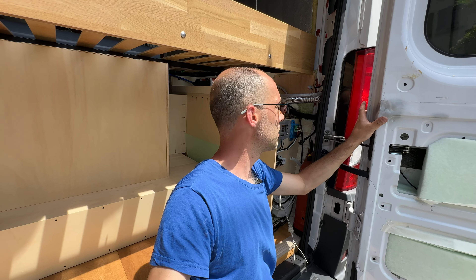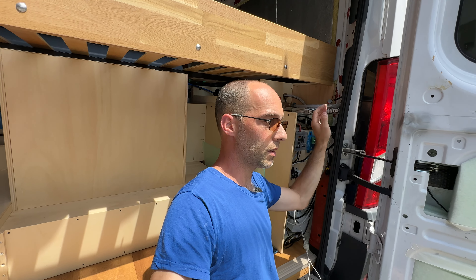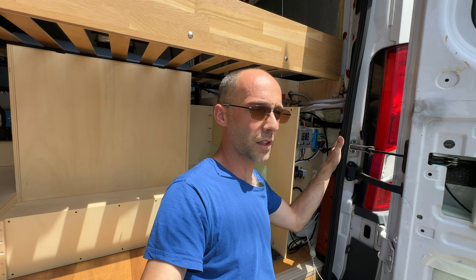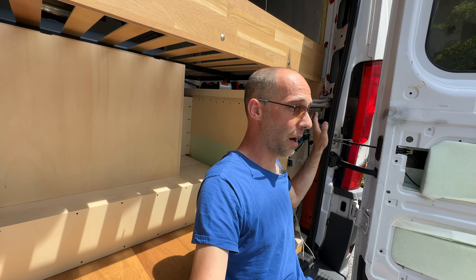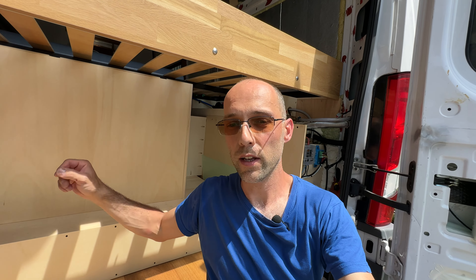Apparently, because I didn't have the plug installed by the factory, there's no power there. I tried to look into the fuse box — the fuse is there, all the relays are there, not sure what's missing, probably there's a connection lost somewhere. It's not a big deal — I just need to find a 12V wire that has power under the ignition key. Every time I switch the key on to drive, I will have power on this wire that goes to the electromagnet so the drawers will stick in place automatically and I will never have to worry about locking them before driving.